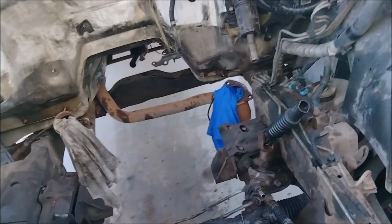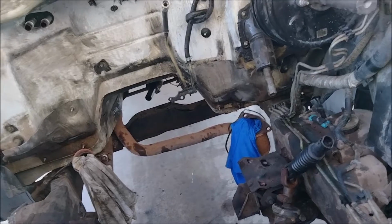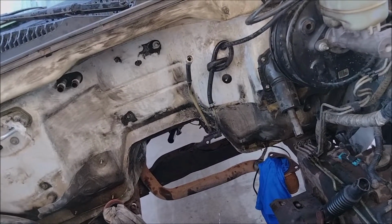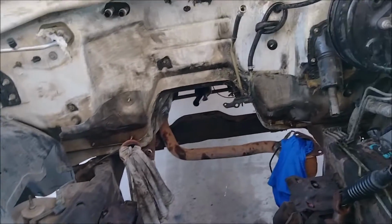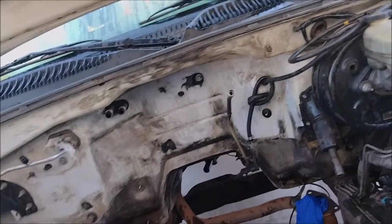On this truck, luckily, it's an 05. Originally it was returnless, but at some point in its life they put a return intake on it, and then they just plugged the return with a bolt, and it caught on fire. And they melted some of the plastic and stuff. There was a hole drilled in the top of the gas tank with JB Weld on it, and then it was leaking gas when you'd fill it up. There's all kinds of craziness when I got this truck.